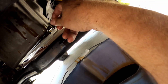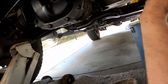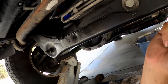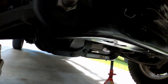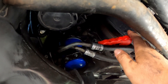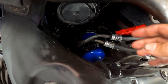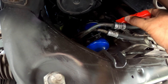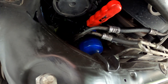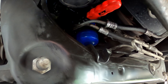You can use the same bucket to drain your filter as well. What's nice about these Hummers is they have a little spout for the oil to come down into your bucket. I wiggled my oil wrench up in here above the lines so it holds itself, and you just play with it until it loosens — it's pretty simple. Once you get it to tighten onto that filter, the oil is going to pour right down into the bucket.